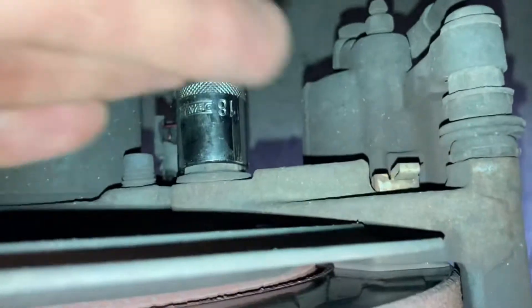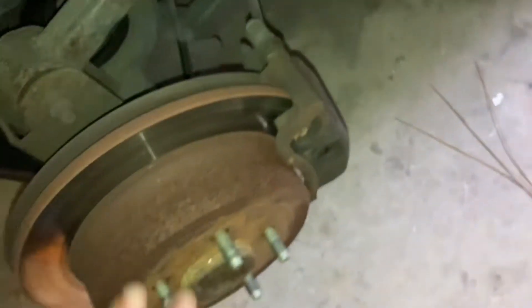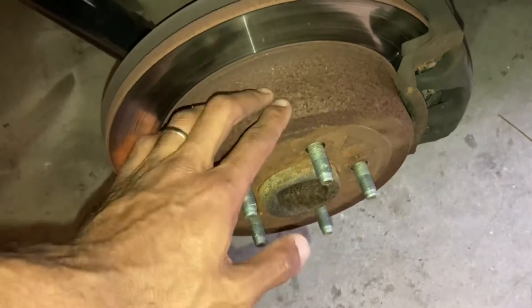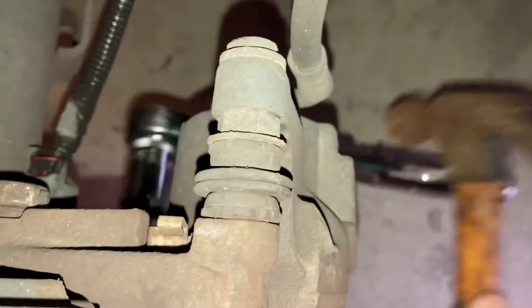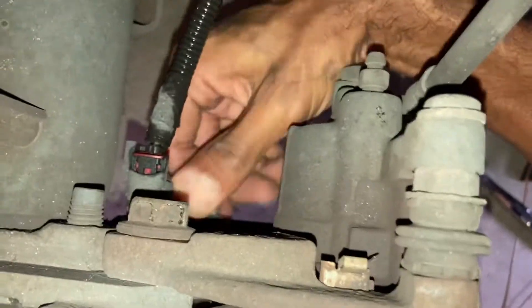I found the light on my camera. It's an 18 millimeter to take this bolt, and there's another bolt down on the bottom to take the whole caliper out. I want to take the whole caliper out of the way because I'm gonna take this whole disc off — there are actually shoes in here for the emergency brake. I'd like to look at it while I'm here. I got my 18 millimeter socket with the ratchet and I'm beating it down to break it loose, then loosen it up.